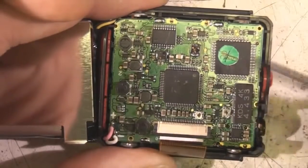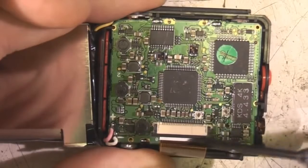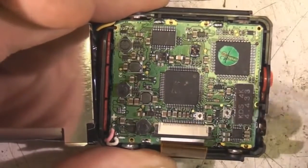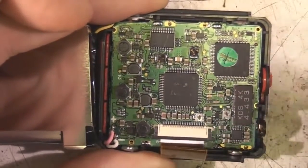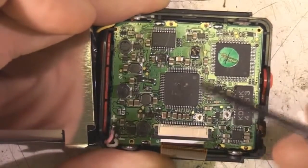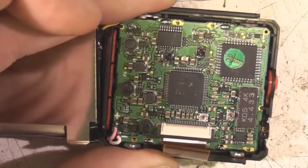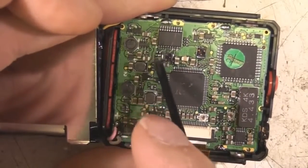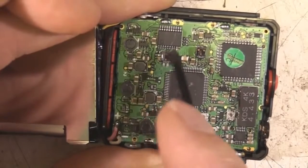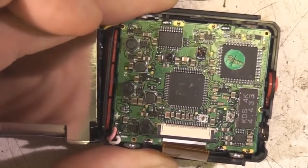With TVs like this, and also the earlier pocket TV type products, the LCD actually had analog drivers, so the actual waveforms applied to the drive on the LCD were analog all the way through. There wasn't any digitization process. Also here there's a UPD6467, which is an on-screen display chip, so that's obviously displaying on-screen graphics and menus, and also that watch display.